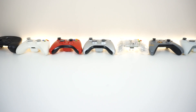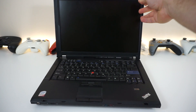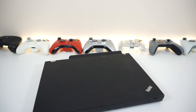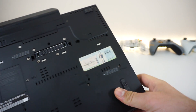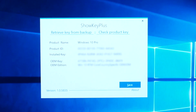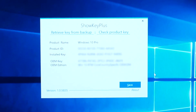Now let's talk about how to get the key out of an old computer. Here I have my ThinkPad from 2008. If it's a laptop or desktop running Windows 7, there's a good chance the sticker will be somewhere on it. But if your sticker is wiped out, I'll show you how to extract the key if Windows is still alive and activated. Use the program called Show Key Plus — link in the description. Turn it on and it will automatically read whatever key is installed. It works for Windows 7, 8, and 10. Click save, save it to your flash drive, and then proceed to install Windows.